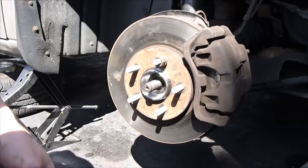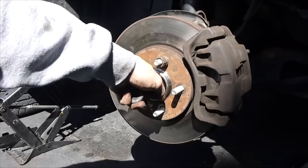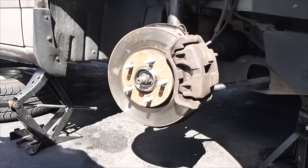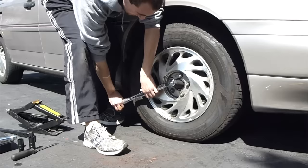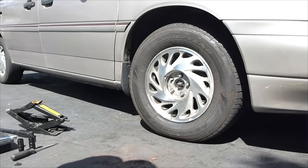The last thing we have to put on is the washer, which goes on like that, and then your bolt. This gets torqued to 200 foot-pounds. Tighten this really tight — that's not even 150 foot-pounds yet. You just want to make sure that's tight so you can put the tire on. Now torque it to 200 foot-pounds. Now go for a nice easy ride, make sure everything's good, and you're done — you just changed the wheel bearing. Like the video if it helped out, and subscribe if you want to see more how-to videos.